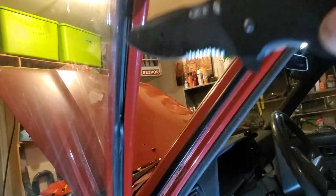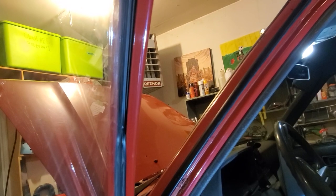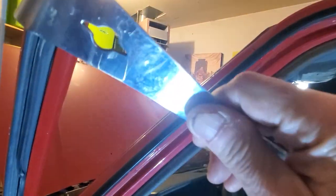There's this rubber seal that goes around all windows. And this one's kind of folded over. So I'm getting a ton of wind noise. I just fixed the other one. You can see how it's just kind of mashed up there. So the window doesn't actually fit up into that slot of rubber. So just crank the window up and the cardboard's keeping it separated. And there you go, nice and tight. Should have no wind noise now, well, or less anyway.